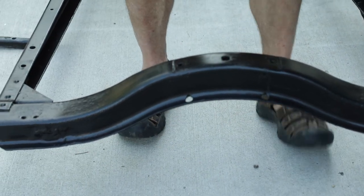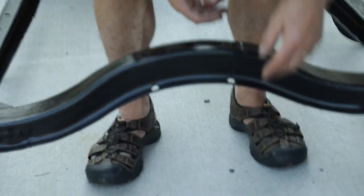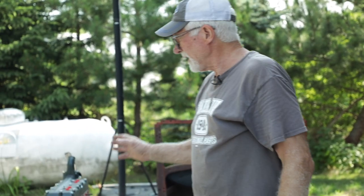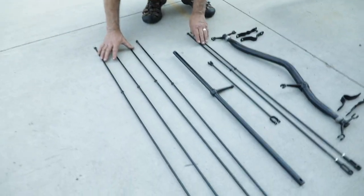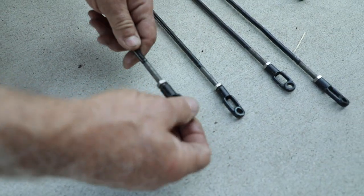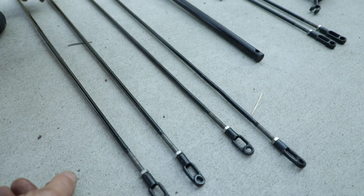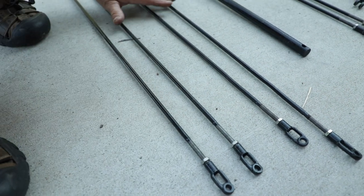The clamp for a woody is a little bit different because it has a bolt hole at the end that holds the exhaust pipe, which needs to be extended a little further since the car is longer than the average Model A — otherwise you might get exhaust fumes back in. Once the rear and front ends are on, we work on the brakes. There are six brake rods here that need to be adjusted to exact lengths per the book. These are all new — we had to replace them, ran a thread chaser on the threads, sandblasted, and painted them.